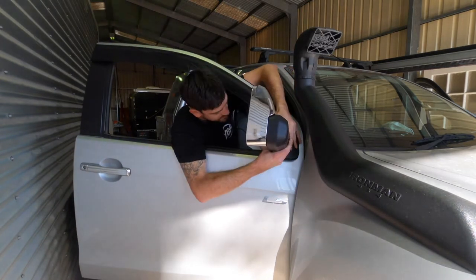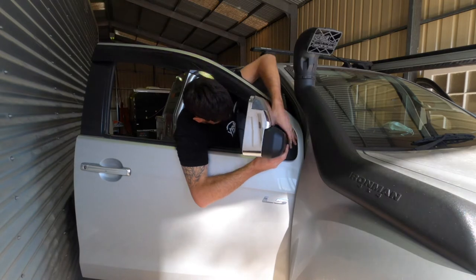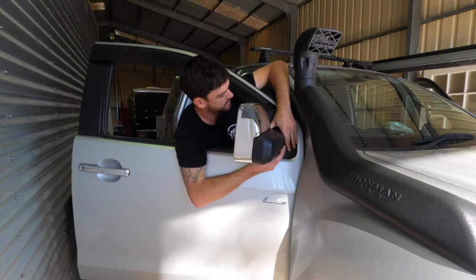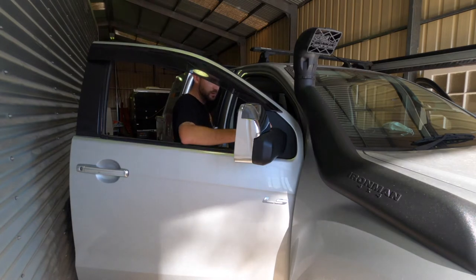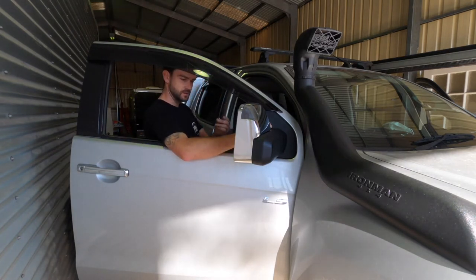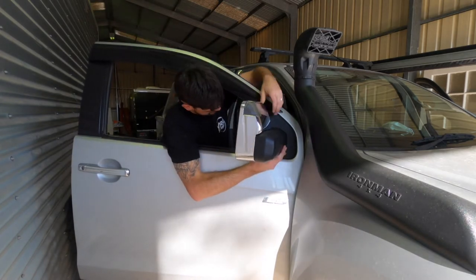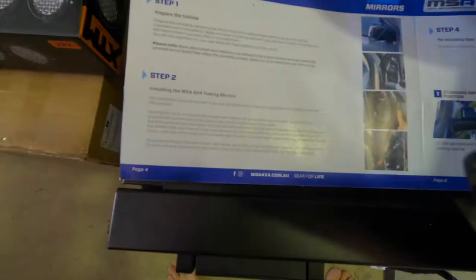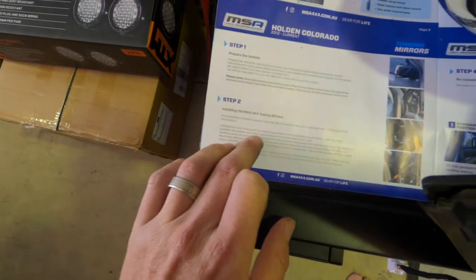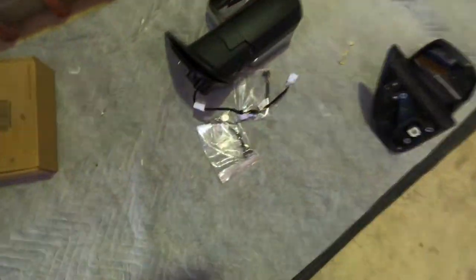There are a couple of little pins that aren't lining up because the wind deflector's in the way, but we're on. Hang on a minute - the new mirrors come with studs and I took little bolts out. We might need to do some investigating here. One on, one off. Hold the mirror in place - use another person to hold the mirror in the original bolt holes, use three M6 washers and nylock nuts supplied. That's why you read the instructions first.